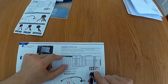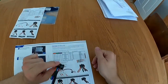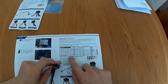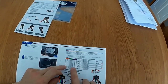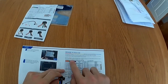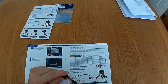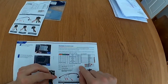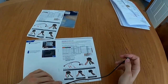You can see this concerns J1, J2, and J3. J1, J2, and J3 are pins 7 through 12 — it's like a jump lead. For Sony, the instructions say J1 link made, J2 link made, J3 link made, so I need links between the jumpers on J1, J2, J3. J1 is orange — keep the link. J2 is green — keep the link. J3 is purple — keep the link. I'll be using the jack connector and won't need key one, key two, or ground.